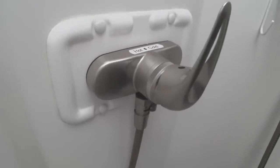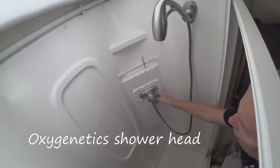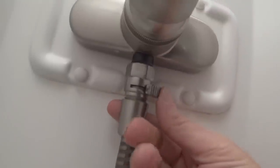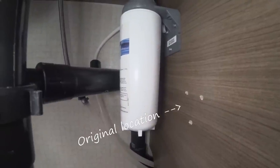I much prefer to know when it's actually closer to empty rather than a third full. One of the first things I put in is a single-handle shut-off. I marked it hot and cold since we don't use the RV all the time — sometimes I forget which is which. That switch turns it off completely. These RVs have a water filter for the cold water line on the kitchen sink, and I moved it to the back just to give me more space for the sink covers.